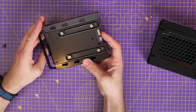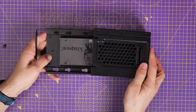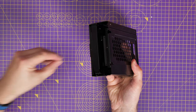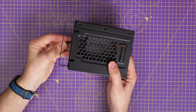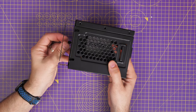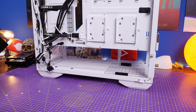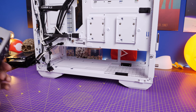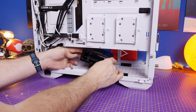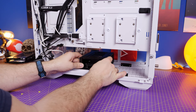The idea here is that you have loads of different mounting points to choose from — where you're going to put these drives, how many you're going to put in. I do find you need to be neater with cable tidying in this case than in other recent cases, otherwise you might have trouble closing the door. Use cable ties whenever possible and make the most of those velcro ties.